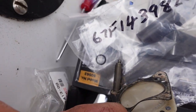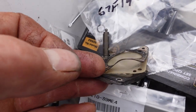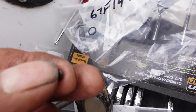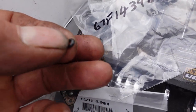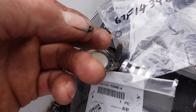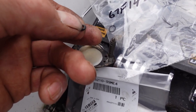Yamaha sent us the wrong o-ring for the end of this plunger rod, so I've taken the existing one off and measured it — it's a 2.5mm diameter by 2mm section o-ring. You can probably buy 10 of those for a couple of quid off eBay, which is what we're going to do.